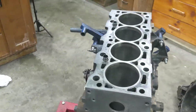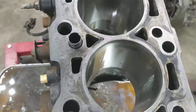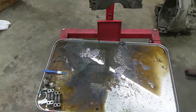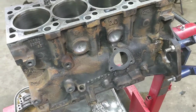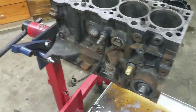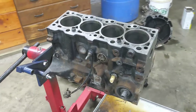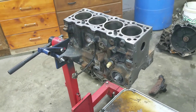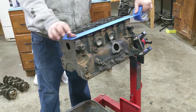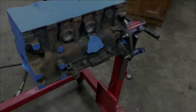With three cans of brake cleaner, two cans of engine degreaser, and a bunch of acetone, I think I have this cleaned up. I did rewipe the bores down with a little WD-40 just so we don't get any rust — same with the mains. You can see the filth that came off these things — just nasty. This one had a fair amount of rust on it, but I got most of it to break loose. Now I'm going to get it masked and ready for paint.